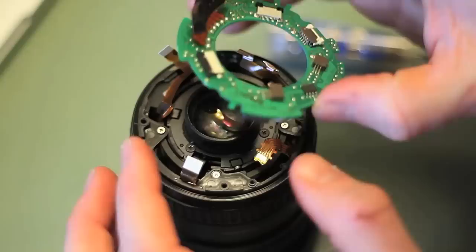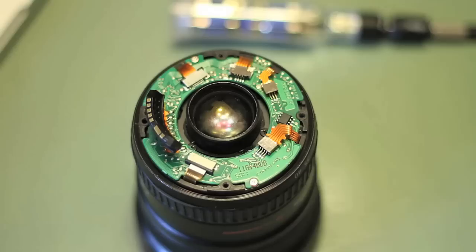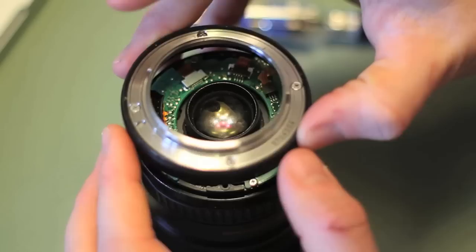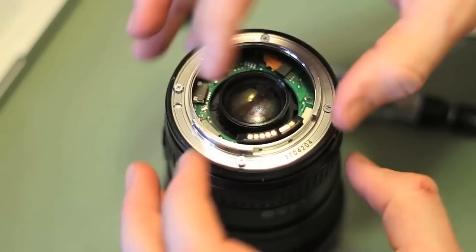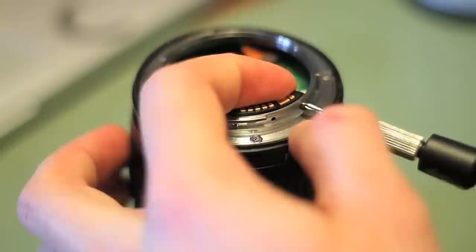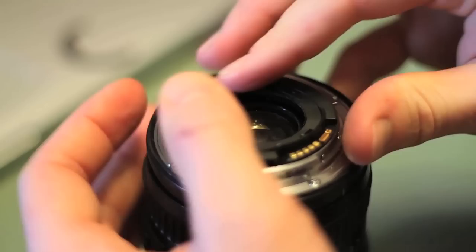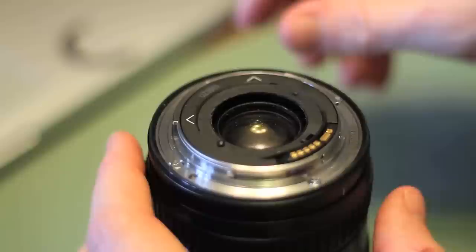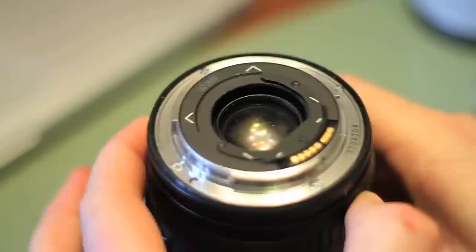Next comes the electrical circuit board, and just getting the right ribbon lined up with the right connector. Now you've got these two screws — opposite sides, remember. Now the circuit board is connected. You just have the little red dot band — line up these four holes. I made the mistake of putting the lens mount in the wrong spot — these two little holes have to line up with this black connector piece because they hold it down. Don't forget about these two little guys. All that's left is to pop in this inner plastic ring — it has four tabs that click down. And this little U-shaped piece. Now you are good. You have a zooming lens once again.